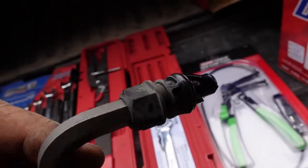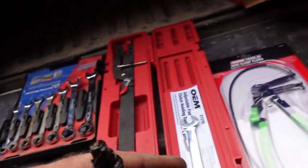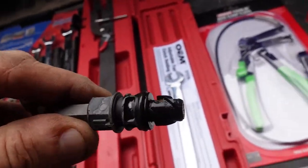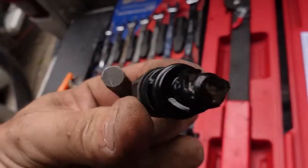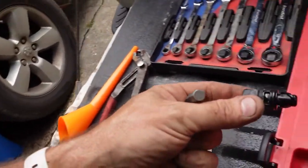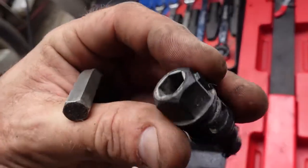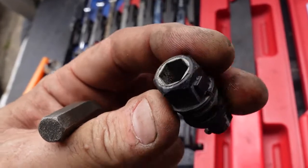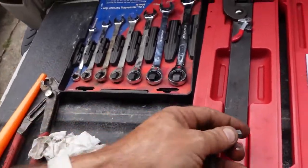That is a drain, but it's really the silliest thing I've ever seen. Very, very coarse thread. I mean, that's a serious thread, and the easiest way to do it is with a big honking metric Allen wrench. It'll take a 16 millimeter, but because of those stupid square notches, you can only put it on two ways, and then you get jammed up. Just dumb. Oh well, Dodge.